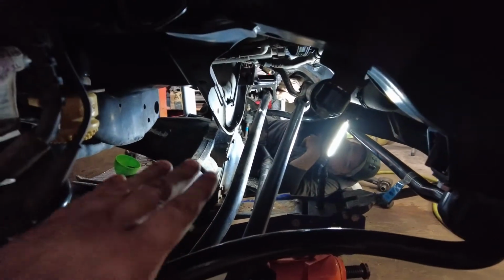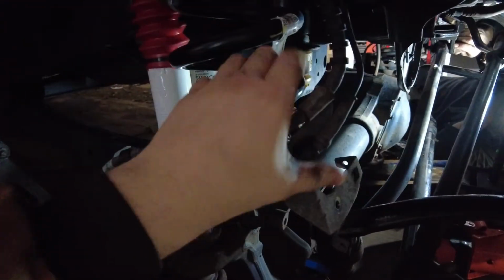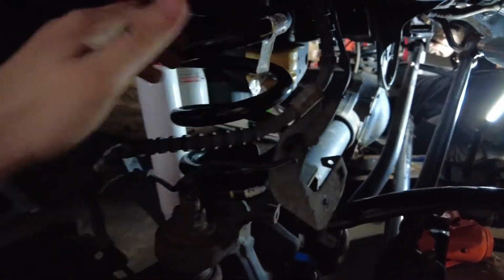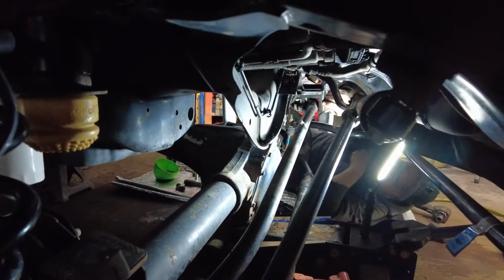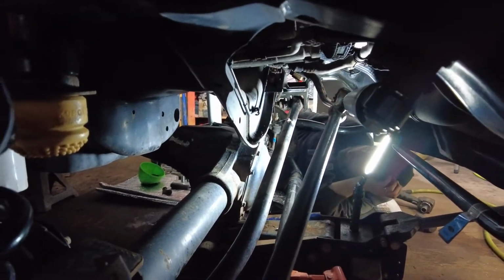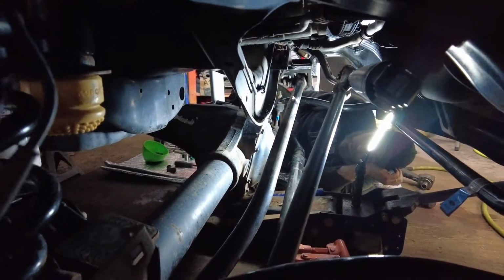But just keep that in mind that it can be a challenge, because if you follow the directions, they want you to button up the shock and all these things. But if you're lowering the axle again, make sure you loosen all this so you don't bust brake lines and you don't overextend your shock. So with a little tinkering, you should be able to get it, but we just wanted to elaborate on that part, because if you follow the directions, it still might not line up for you.